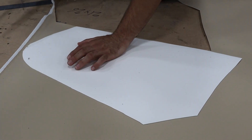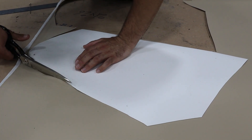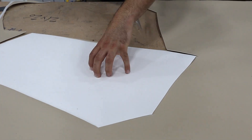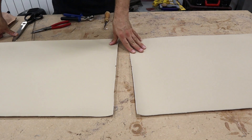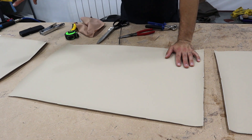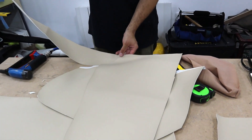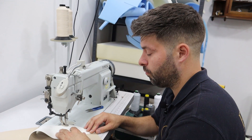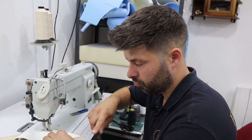Make sure you give yourself enough to staple off at the bottom — there's a nip there and you can see where the staples are. Allow enough; I'm going to go about half an inch bigger. Because it's a vinyl with no pile you can turn it whichever way saves the most fabric. With velvet it has to all go the same way, but with vinyl you have freedom. The plan for stitching — because it's sewn in one piece — is: sew the outside back and inside back together, sew the seat on, making one long piece of fabric, then attach the side border and run it all on in one movement with the top stitch.